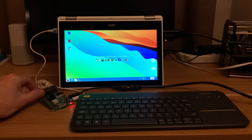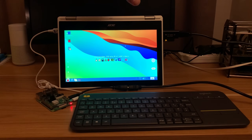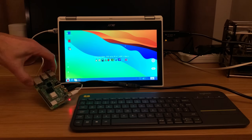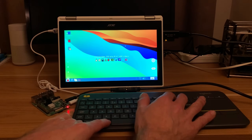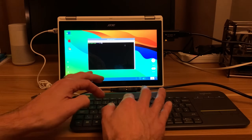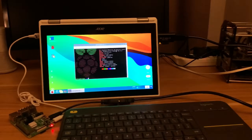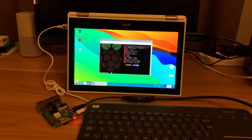I thought I'd better also show it running with a Pi 4. Here's my Pi 4 - the HDMI cable goes all the way around and into the adapter, all again being powered from the Acer Chromebook. The output goes from USB-A to USB-C into the Pi, and I've got a keyboard dongle because I'm using my Logitech keyboard. If I do Ctrl+Alt+T to open a terminal and run neofetch - yeah, this is a Pi 4 4GB model. Anyway, I hope all this helps, thanks very much for watching, please like and subscribe.